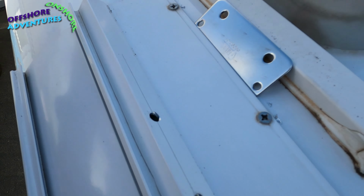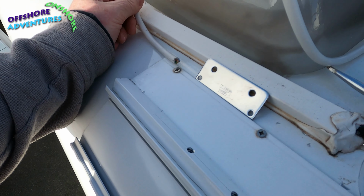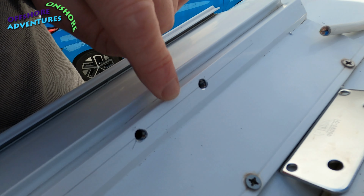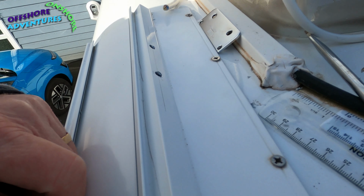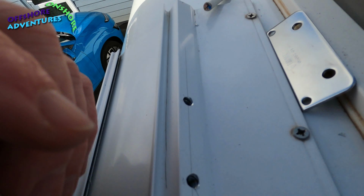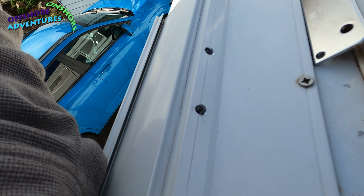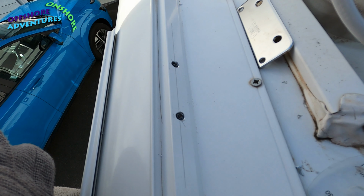And so that's with the two holes drilled. Okay, I swapped from the screwdriver because the handle was too big, and I just used a bit of cable to push the little M6 nylock into position. If you look at the hole there, you can just about see the threads of the nylock that's been slid in down the channel there. So fingers crossed that all stays in place, but they seem to line up okay. Now for the last bracket, once we've drilled, we'll offer up the awning itself and just see if we can get these first plates on to start securing it in place.